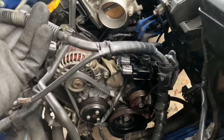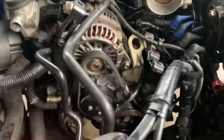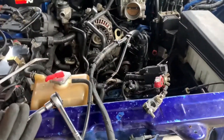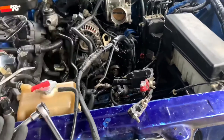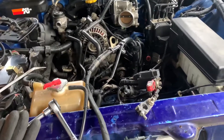Getting started on the RX-8 today. I believe this is the starting wiring harness. These two connectors go to the starter. After that, I have the ECU connected and all the fuses, so really it's just finding all the holes for the random little plugs. Once I get that done, we should be able to crank it over. Make sure everything's hooked up, lights, intake, and she'll be ready to rock and roll. Let's get started on the starter.